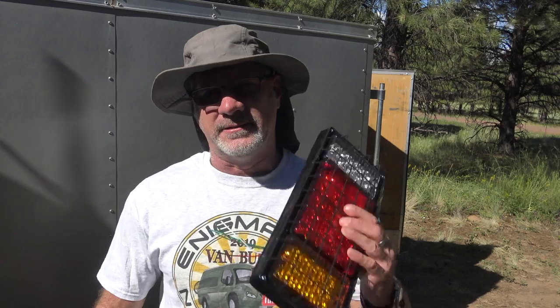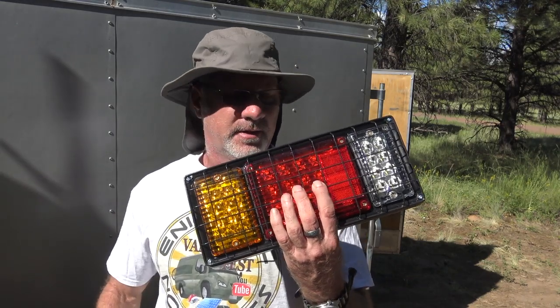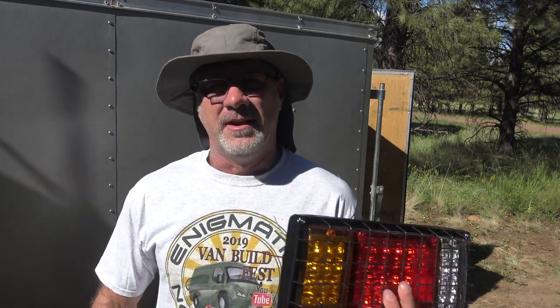So it's just a quick video I wanted to get out to you so you don't end up going through the same frustrations that I did. Most of the tail lights you just buy at the hardware store — AutoZone, Pep Boys, whatever — are going to be four wires. I had to dig a little bit to find these five-wire ones, and I'll plug a link in the notes to these exact ones. Even if you don't get these, just make sure if you've got a five-wire system that you get a five-wire tail light and save yourself a little grief. Thanks for watching and I'll be back soon with some more information about the van build.